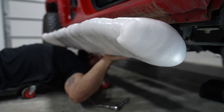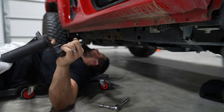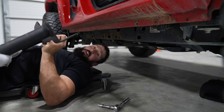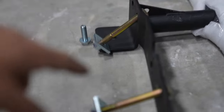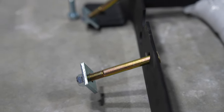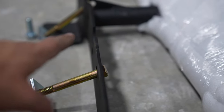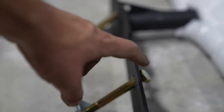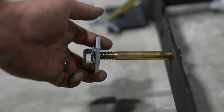The bottom of these sliders has three tabs utilizing two of the fuel tank skid plate bolts, which will help with the install. The hardware includes four and a half inch grade 8 bolts, big one-and-a-quarter inch square washers, and lock nuts. Once you get these hung up on the side of the frame rail, there are already holes in the frame — no drilling required. You stick the big bolt through the slider, through the frame, then washer and nut on the opposite side of the frame.